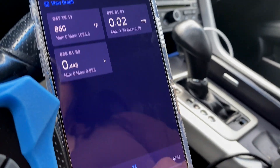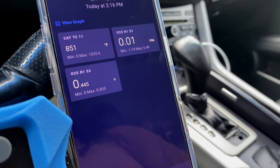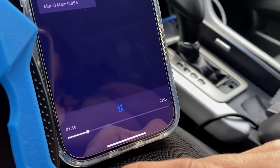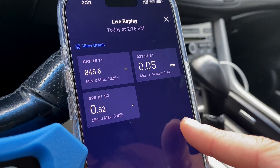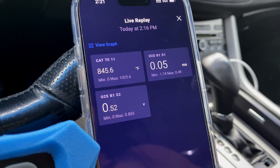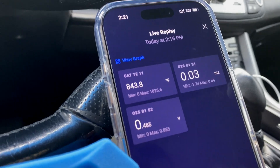There is nothing — if we speed it up a bit, there we go, that's at 136. Everything looks fine. I'm literally getting the same exact reading as when I first got the RDX and I ran live data. It's the same exact thing. There's nothing off, nothing different. So now I know that the oxygen sensors are okay, and it is not a reason or an indirect reason why this P0420 code is popping up on the RDX.